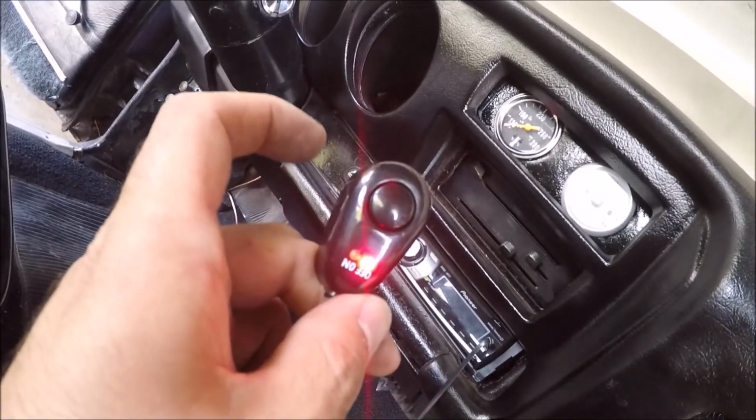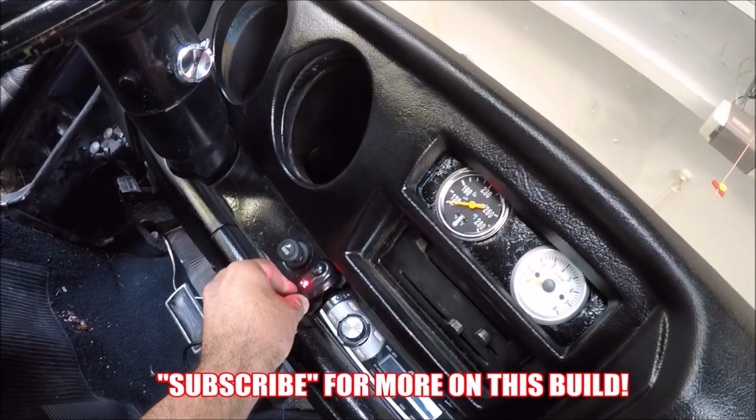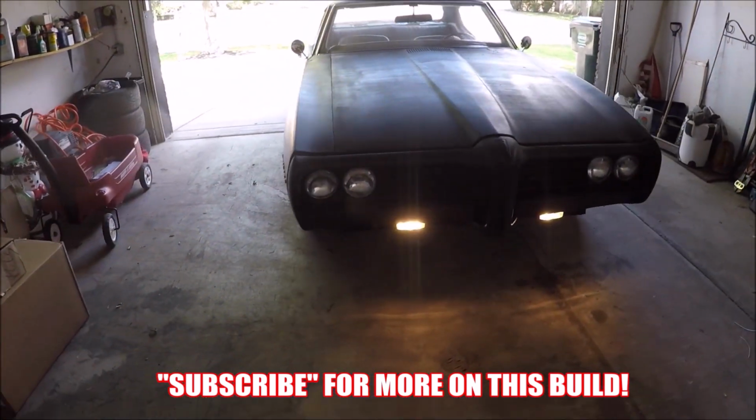So after I came out through the firewall, I actually hooked up another ground right on this box right here, which is metal, and that gave me a good ground. This is the switch right here, which I'm gonna go ahead and mount in the best place possible, possibly right there, but you guys can put it wherever you want. Fog lights are done, and that's pretty much gonna be it.